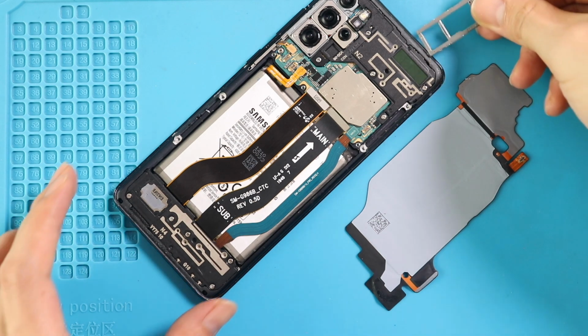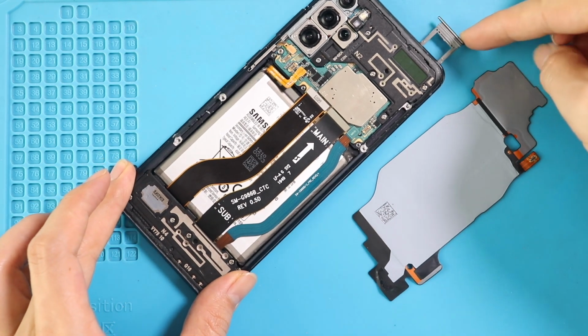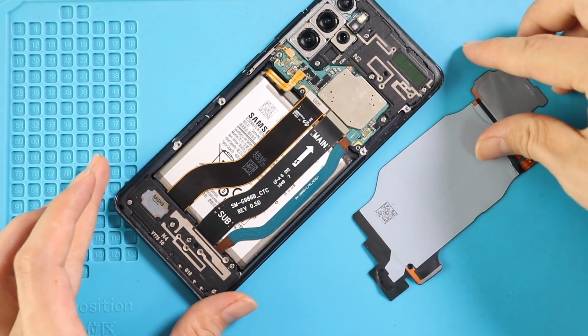Next, before placing the wireless pad, it is good to connect the battery plug and test the screen functionality by powering up the device. Once the testing has passed, next, add the SIM tray and place the wireless pad by securing the connector.